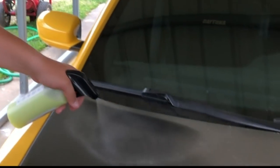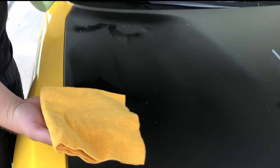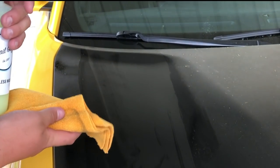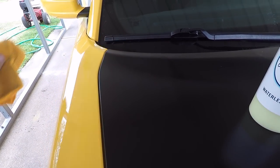You don't need to use this much product — take a clean microfiber rag and do a straight-line wipe. You can see what your towel's going to look like; flip to a new surface every time. No water was required to clean the surface. Waterless wash is the most effective way to remove light to medium surface dust, fingerprints, and other minor contamination without harming your clear coat. If you live in a state where water is limited, or you're at a car meet in a pinch, waterless wash is your go-to. I'm also going to try it on vinyl — my car is loaded with vinyl — just a quick spray and wipe. No residue is left behind and all the pollen is gone.